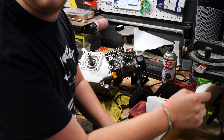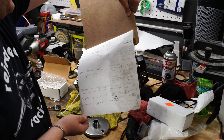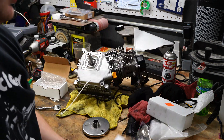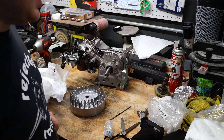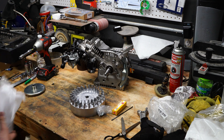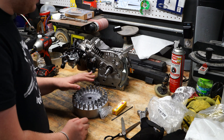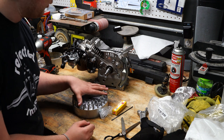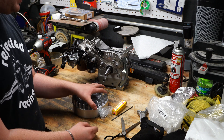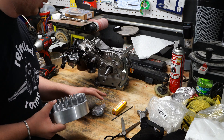According to the master rejected content sheet, torque specs for the side cover are 17 foot-pounds - that's Owen's handwriting. This is our new flywheel. As you can see, it is not a full billet wheel - it is the reinforced wheel rated for up to 10,000 RPM. I chose this because it's about a quarter of the cost of the full billet, and being that this is a fully stock motor just governor-deleted, the 10,000 RPM rating should be absolutely no problem whatsoever.